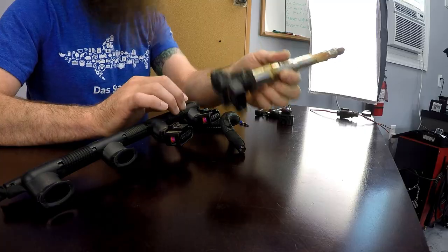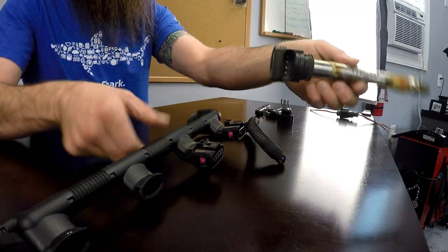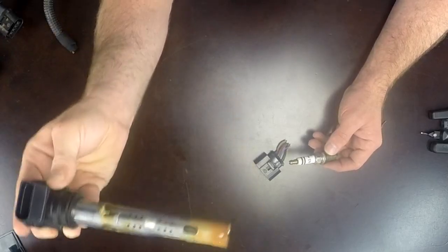This connector is what provides the electrical connection from the ECM to the ignition coil. The ignition coil is what actually fires the spark plug — I have one saved to do a parts failure video on in the future. We're specifically talking about the connection between the two. Coil-on-plug means the ignition coil sits directly on top of the spark plug, instead of using a distributor or a coil pack with spark plug wires. This puts the ignition coil and spark plug wire into one unit, and Volkswagen has had more than their fair share of failures on these.